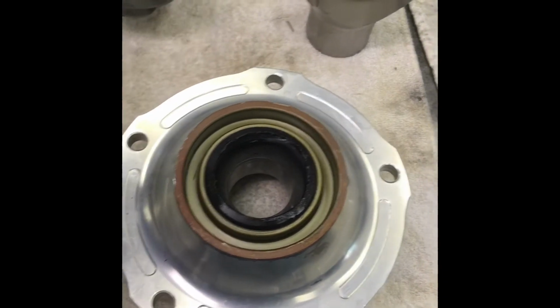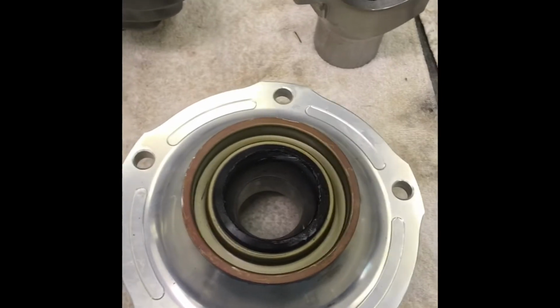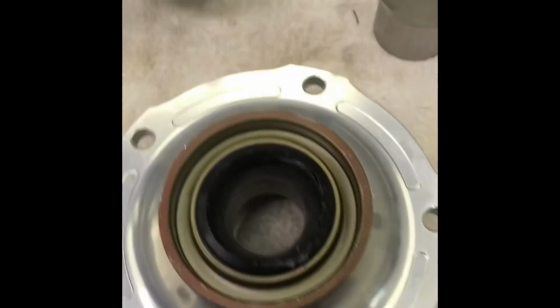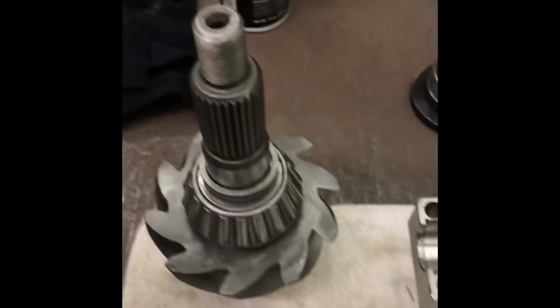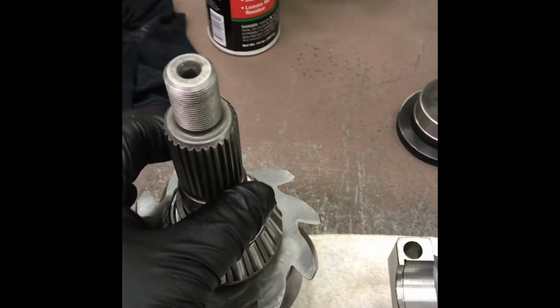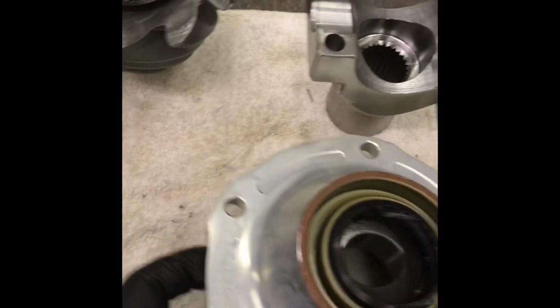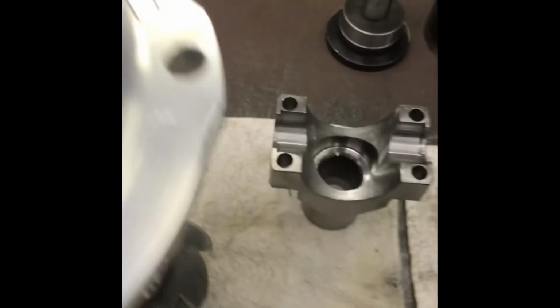You could have this sitting on the pinion and try to put the seal in around it. It works too, especially with the long driver like that. That's why it's so long. But now you've elected, like me, to put the seal in on the bench, and that outer bearing's kind of a push fit under there. How are you going to get that on there? Boy, that's a genius move. I hope you got a box of seals. No, wait a minute. There's always a trick.